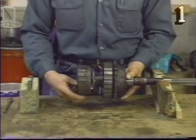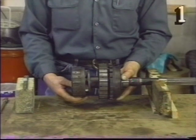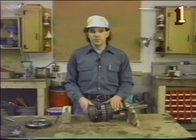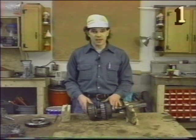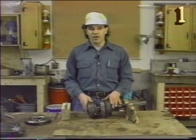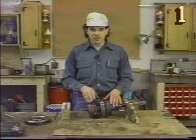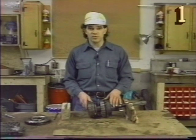Combined, these will give us a low, a medium, and coupled directly together will give us our direct or third gear and reverse. All of the other components of the transmission, such as our clutch packs, our one-way clutch rollers, the valve body, all together control which direction and which sets of planetary gears are coupled together, which give us our different ranges of the transmission.